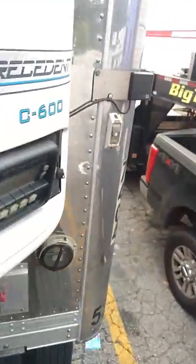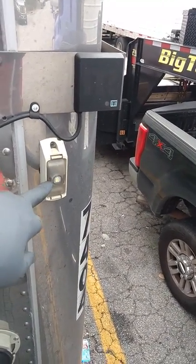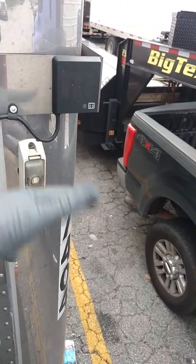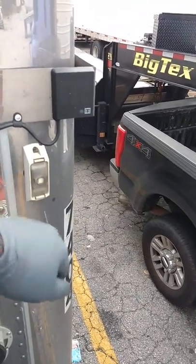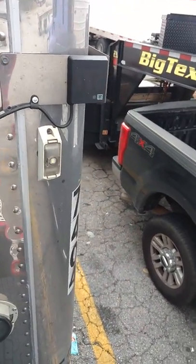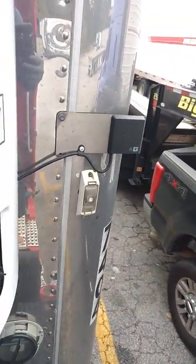Last but not least — this light right here is for your tire inflation system. If that light is on during your trip, you have an air leak somewhere in your tires and it's losing air, so it's coming back on to inflate your tires. If you see that light flickering on and off, that means you have an air leak — maybe you ran over a nail. If it's constantly staying on, you might want to stop and get that fixed. It can possibly keep enough air in the tires to make it across the trip, but when it keeps coming back on it's letting you know it's losing air. If it's just constantly on, you should get that checked out.